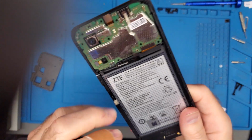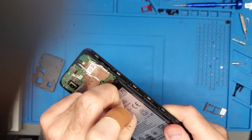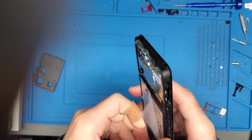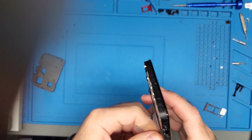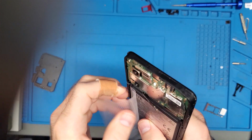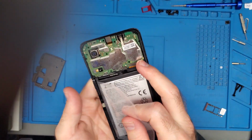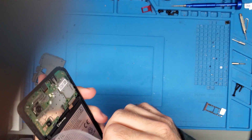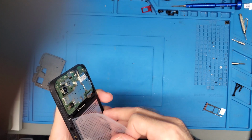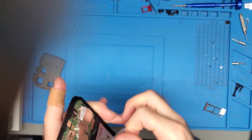Now I'm pretty much at the point where I am ready to give up. But there is one thing left to try, at least, which is to remove the battery and give the battery a jump start. I'm going to have to check the battery's voltage first before I do this, as I might find that maybe it's already at 4.1 or 4.2 volts and doesn't need to be charged at all. That is a possibility. So we'll look at that first.